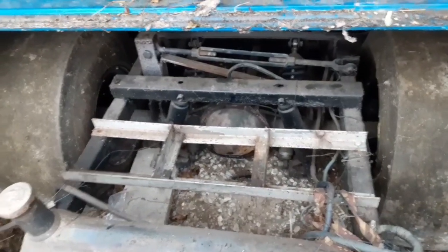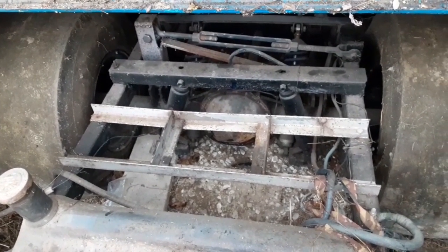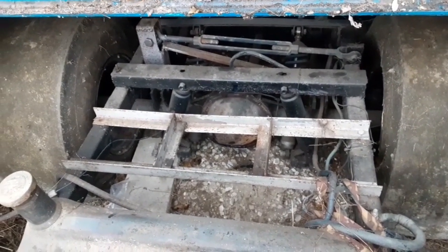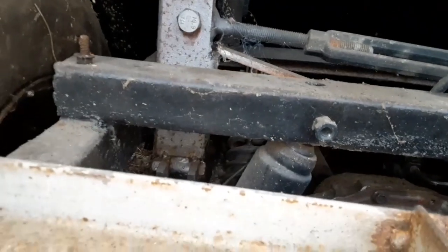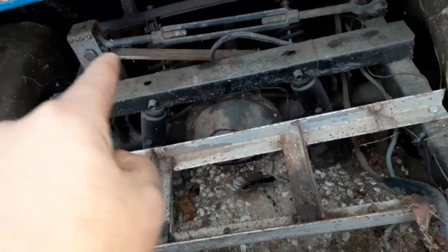In the 70s, Dad and his friends put this car together in a junkyard with a stick welder and used steel. It's a little different now than it was when they raced it. When they raced it, that wasn't here. The top link originally went down on top, directly on top of that bracket on the rear end. So the top link was almost as much at an angle as that piece of flat bar is. So when you hit a bump or anything, the back end of the car would go side to side.